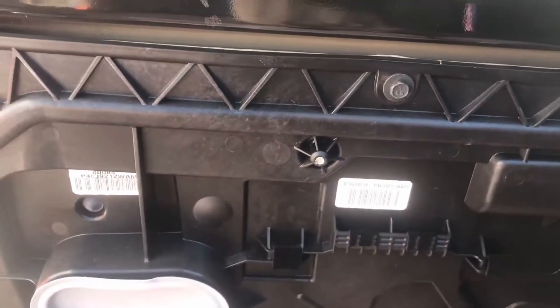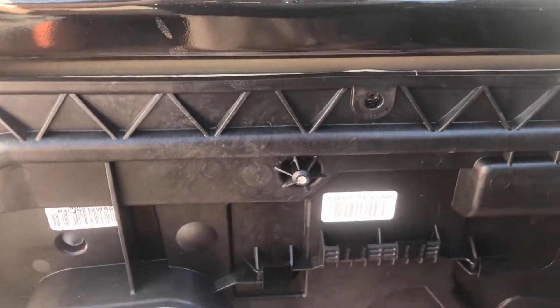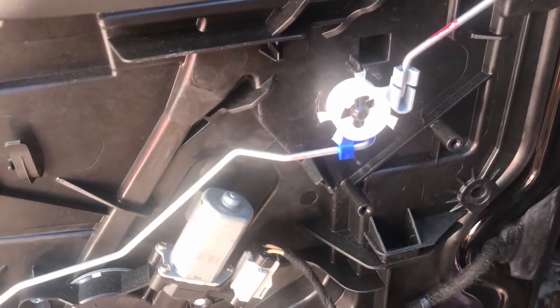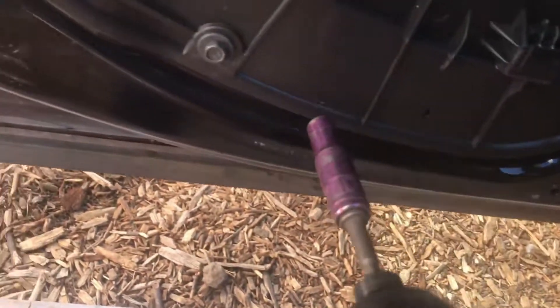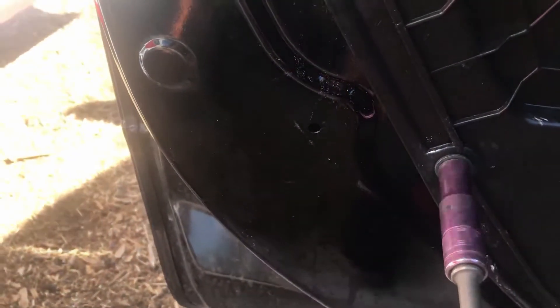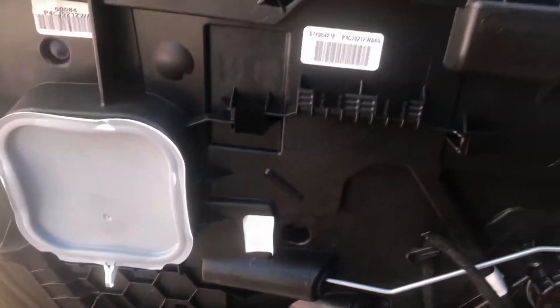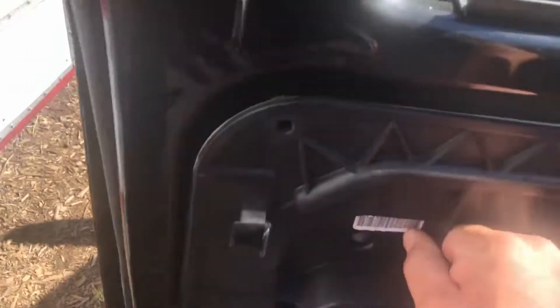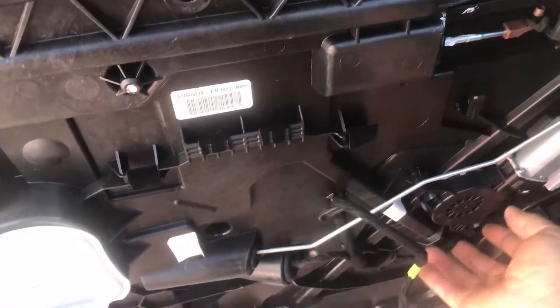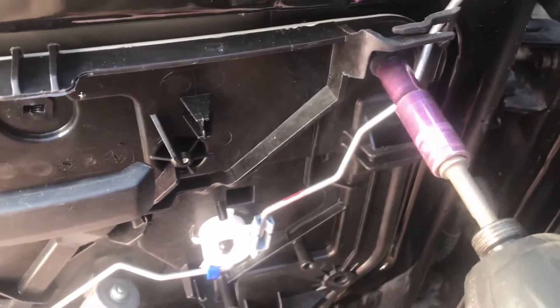Dodge has made this a lot easier now. We come over here and remove these 10mm screws — there are about six or seven of them around the door. Let's get started taking these screws out so we can lift up this panel. There's some sealant on there and there's one more screw hidden behind the locking cable — watch for that one tucked away.